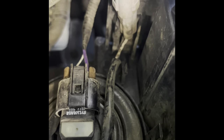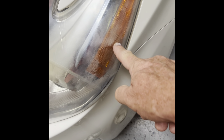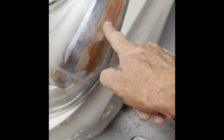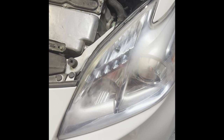Now that's what I'm coming to here — my problem was these side marker bulbs. The white bulb under here, which is under a yellow reflector — these are out and I can't pass inspection with those out, so I had to get them replaced. I went to see how much they were, and at Toyota, for each side it's $80 for these on both sides and $80 for these on both sides — could be more or less, but I was looking at a $200 bill for bulbs. So I went out and got some 2825 bulbs.